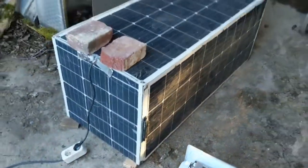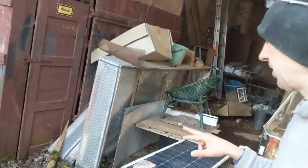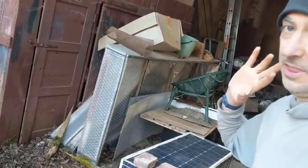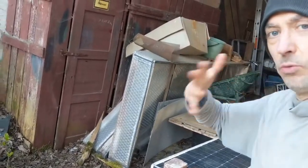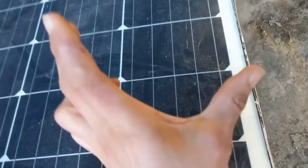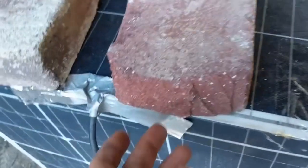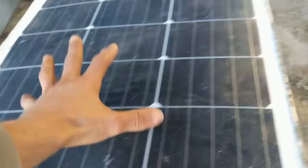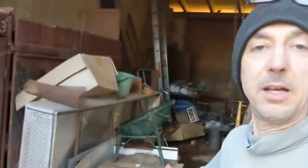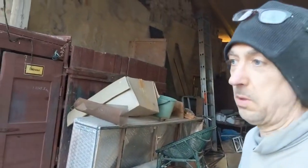And this is not meant as a Faraday cage, and I think that's not needed because it should protect from the inside to the outside. And therefore, the microwaves only need to be reflected, and therefore we need this metal inside so that they always get reflected. And the wavelength, I think, is about 12 centimeters, so they cannot sneak through. And so, yeah, this may work, but when I put a smartphone inside with the WLAN hotspot, there was still signal strength outside.